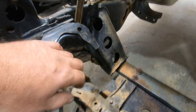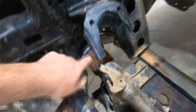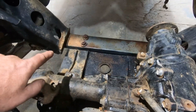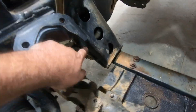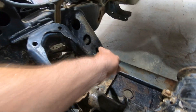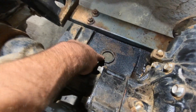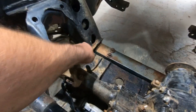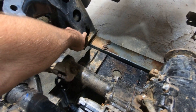One other issue I think I might have is this plate right here that ties the frame down into the back of the lower control arm. Mine was cut open here — this truck had a drop bracket lift when I bought it and I got rid of it, so I welded a piece back in. But I do think this might be in the way of that oil pan because it is a lot bigger than the V6 oil pan. Plus the oil drain kind of shoots out that direction on the Tundra engine, and on the Tacoma engine I had an access hole in my skid plate. But this one's going to point the other way, so I might have to rig something — or maybe I'll get lucky and it'll fit right there so I can just go up through that hole to drain the oil.